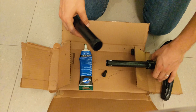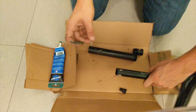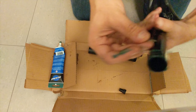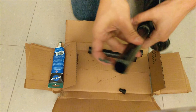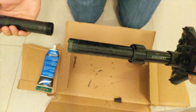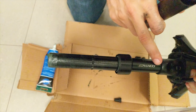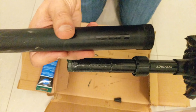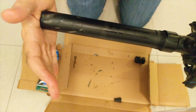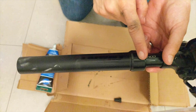The inner tube will slide back in. A little bit of extra grease there won't hurt. Before we put this in, we have to put those two little plastic guide pieces back in — they slide into the plastic and if you get them in right, they'll stick. Once they're in, also put some grease below the collar. Now you have to get the two pieces back together. There are notches to align, so one easy way is to make sure 'Contact' lettering is at the top on both pieces. If you have them both facing up, it shouldn't take too much fiddling to slide them back into place. Then tighten the collar back onto the tube.